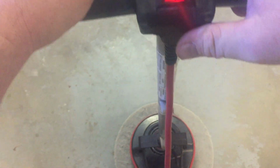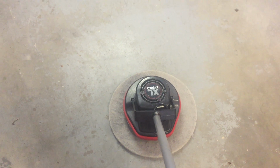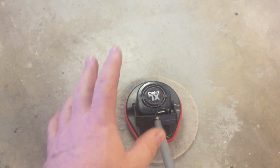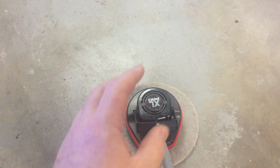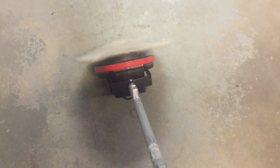One of the ways you can tell if the bearing is going is when you shut something off, whether it be a vacuum motor or whatever. If you hear it kind of growling as it slows down, that's your indication. Let's put it upside down. We'll try it this way. Yeah, definitely not a happy bearing.